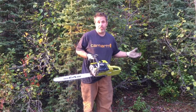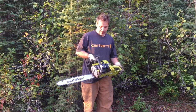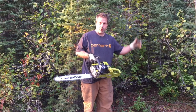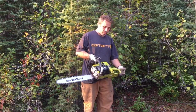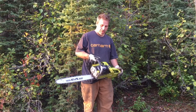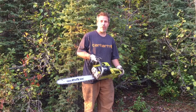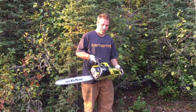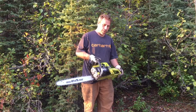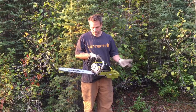And it's 52 cc's, so I'm just going to run it. I'm going to keep this for a long time, and then I'll do a review down the road, maybe in a couple years or something. I'll do a follow-up video after I do some decent cutting, but so far it's good. It's running really rich right now, you can tell in the video. Once it's broken in, I'll adjust it a little bit leaner. It's running lean on the low end, rich on the top end, so we'll fix that up and see what we have.